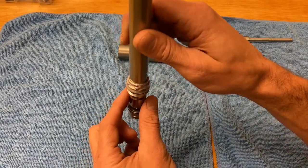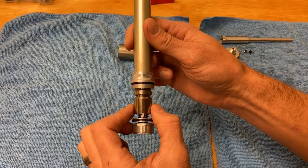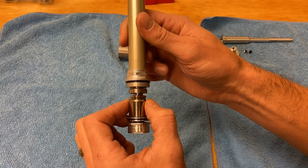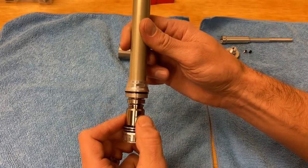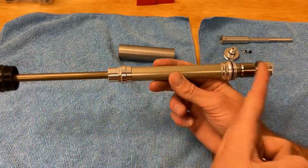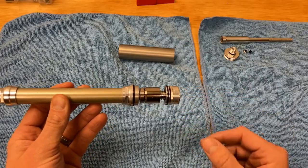As the cartridge itself is pushed up by the bump, this inertia valve wants to remain at rest, simply moving forward. So what happens is the cartridge moves up, the valve stays where it is, and it opens up some ports here. You can't quite see these the way this is shot, but that allows oil to flow through the system. This shaft wants to move into the damper, and this allows oil to flow. I'll take this apart and show you what's worth tuning.